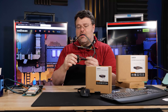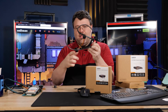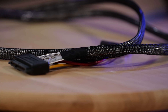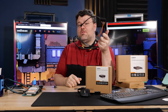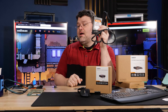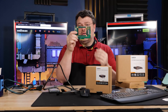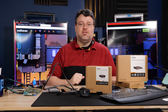PCI Express 4 cabling is entering mass manufacture. I ordered these in July and they just came in — it's basically November. This cable is actually capable of PCI Express 4; they've put some re-drivers in the connector. It works with the WRX80 motherboard, works with my Kioxia CD6 PCI Express 4 NVMe, and also works with the Intel Optane P5800X. So I can use the P5800X without it taking up an expansion slot on my WRX80, giving me all seven slots free while still connecting this super high-speed U.2 drive.